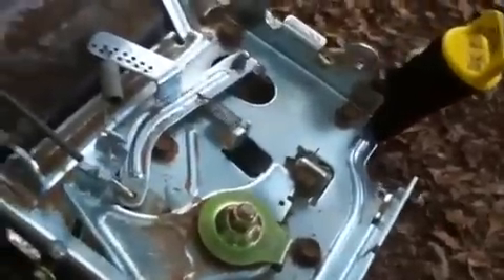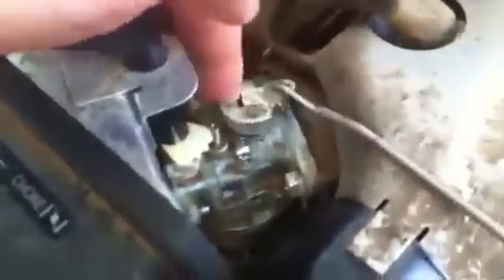What you do is you've got to have your throttle in the fully open position. The way you know it's fully opened is this right here is your idler screw on your throttle. If you've got it backed up on the idler screw, that means the throttle's closed. We don't want it closed — we've got to have it fully open, so we go the other way until it stops. This right here is fully open now.